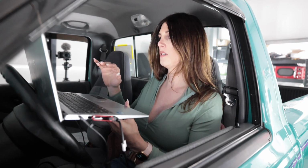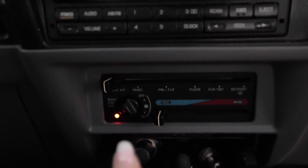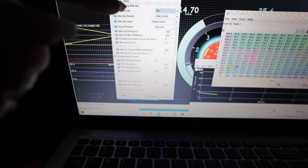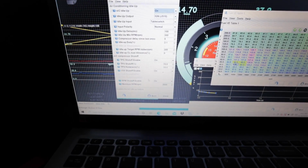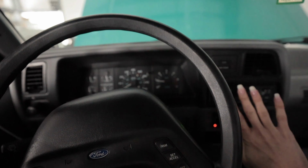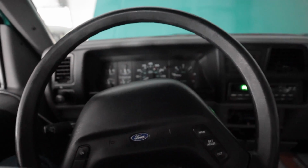On. Okay. AC is on, cycling the compressor. It's actually fairly cold outside right now. Yeah, that's dead on. AFRs are nice and steady with the compressor kicking on and off where it should be. It is freezing in here. That is so cold. It's like in the 50s outside. That's really good.